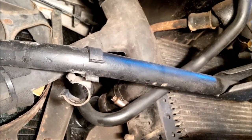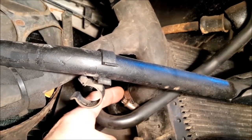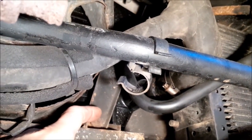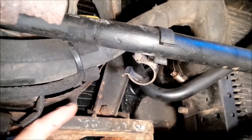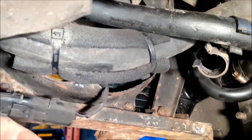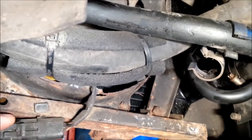Here's how you do it. Working underneath the car, disconnect the lower radiator hose from the right hand side of the radiator and drain the coolant. Then there's this Y shaped bracket which comes down — remove the lower fixing where it goes into the support frame, just there where my finger is. Then come across; you don't need to disconnect the wiring for the fans, but slide the entire connector off its little stud on the support frame there.